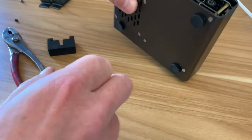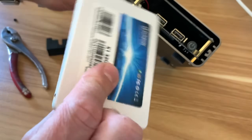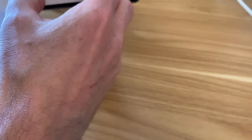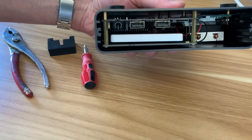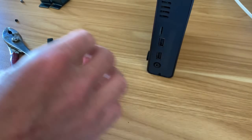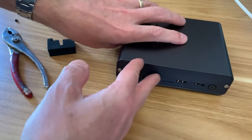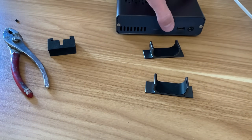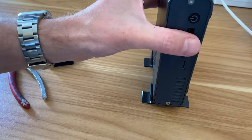The SATA drive is going to go in there. I need to work out what operating system to use - this is a 2GB Pi so I'm not going to put a 64-bit OS on it because they tend to run slower. I've currently got MX Linux on this white 32GB SSD, so let's use that one. You can see the SSD is in there. Putting the front plate on - there are different black screws on the released version. This is the little aluminium stand: you put the two sides together and squeeze it in to stand it upright, but I'm going to leave mine flat.